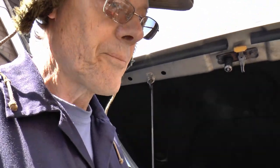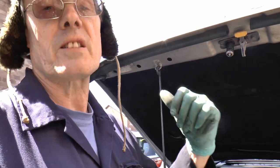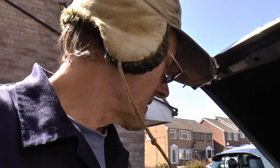Simply key in, twist it, try to turn the ignition, all the lights come on, everything's normal, it's not the battery. Tried to crank it, nothing, zilch. But the immobiliser light's flashing. So, I think it's the transponder thing in the key, but the day before it was fine. It's been fine all the time in that respect. Until last, what day is it? Today's Wednesday, so it was last Sunday. So you ran it last Sunday, and that's when I found the oil in the turbo. Kind of packed it up, came back to it Monday, nothing. So what the hell happens in between? What's going on there? Right, anyway, gonna pop this fan back on, and then we'll start with bleeding the brakes.